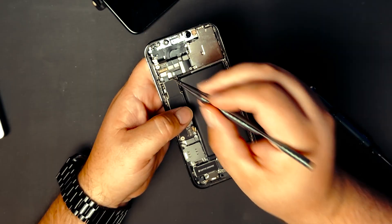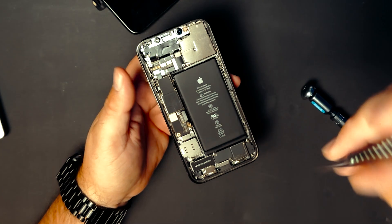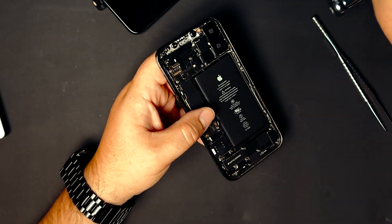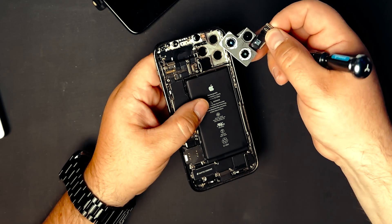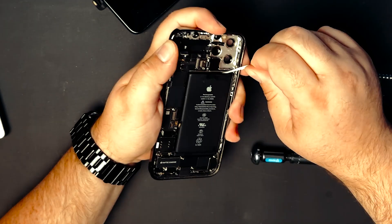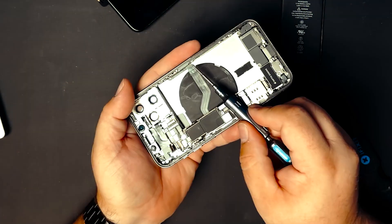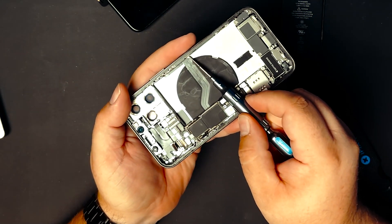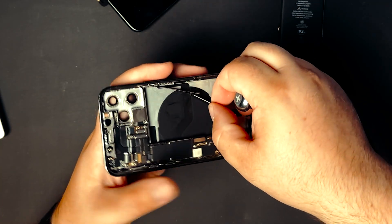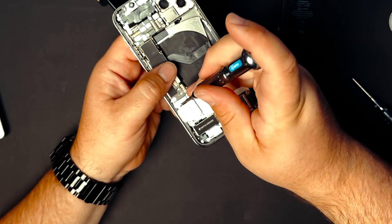Back to this iPhone — knowing that there is an issue on the board, let's take it out. We'll take out the screws for the camera bracket, pop it off, disconnect the camera and pull it out. Now let's take the battery out. Now that we have the battery out, let's disconnect the 5G antenna. We'll go ahead and disconnect it, peel off the sticker, and now we'll take out the motherboard.